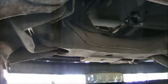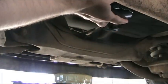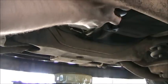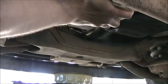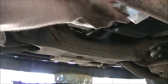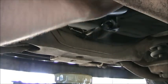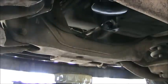Next is the oil filter, which we pre-filled. I'm going to manhandle the filter into position — this one is nice because it faces up and down. Sometimes they're on their side so you have to be quick or you'll spill a lot of oil. Once it's made contact, it needs to turn at least a half turn more. That was about three-quarters of a turn after contact, so this should be fine, though usually they don't go that smoothly. I don't usually use a filter this big — normally I use an AC Delco PF52, which is much narrower.